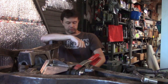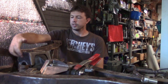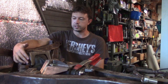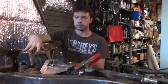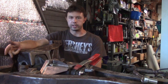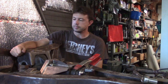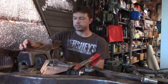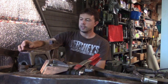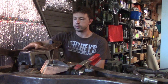Another reason people use this R160 is it has these five bolts on flanges that retain the bearings, which are handy for mounting your leaf spring mount. The Spitfire has a transverse leaf spring which kind of acts as your upper control arm — super janky, I don't like it but I'm not going to change it. The stock differential has an integrated mount cast into the housing, but obviously the Datsun was not the same, so I had to fabricate up this mount.